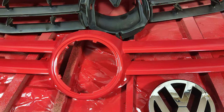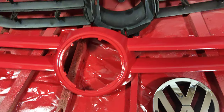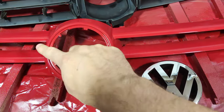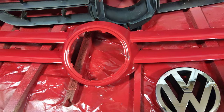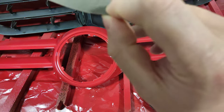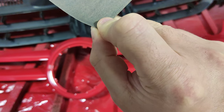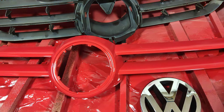In terms of sorting it out, all I did to rub it down was take a sanding block - just a simple sanding block with quite a rough grit. I took off all the clear coat along here, went all the way round, then finished off with a very fine silicon carbide paper.